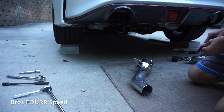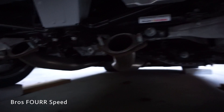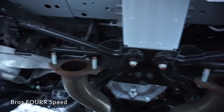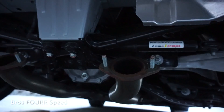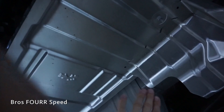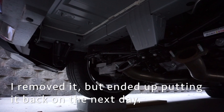I'm going to install the hangers onto the new exhaust, then take the three bolts that came out of the flange, put them in there, and loosely thread them as I stick this onto the mid-pipe. We're going to remove the stock gaskets from each side and use the new ones. While we're under here, it's interesting to look at the Nismo — this is a lot different than the standard Z. You can see a performance damper and a brace along there, so there's a lot of new suspension stuff under here. Some reviews of these exhausts actually recommend removing the heat shield, which might rattle a little bit, so I'll let you know in the description if I end up removing that.